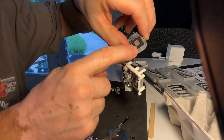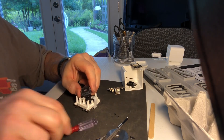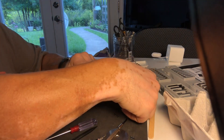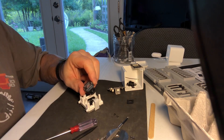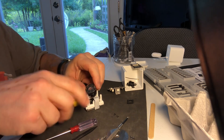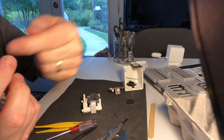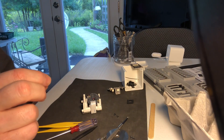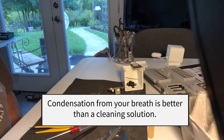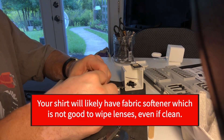I can see the moisture right there. There is a foam pad around the outer portion with an index mark — I'll keep the orientation up and down. There's that disc — I don't even know exactly what it is, probably an anti-halation or infrared, maybe UV filter. It's plastic. Let it fall into my hand — it may have an orientation, so note that this side is toward the lens and this side is toward the sensor. I use a lens cleaning tissue with a little breath — that's the cleanest thing you've got. Don't use any lens cleaner. Don't blow on the back of the lens; you're more likely to introduce dust.